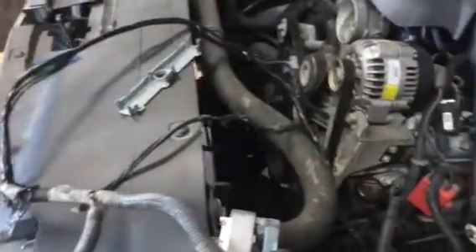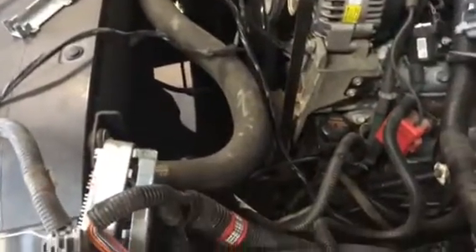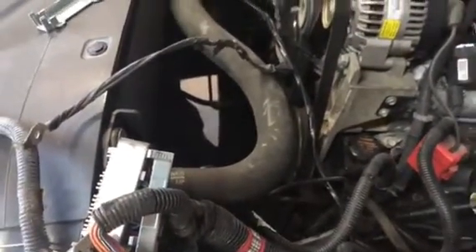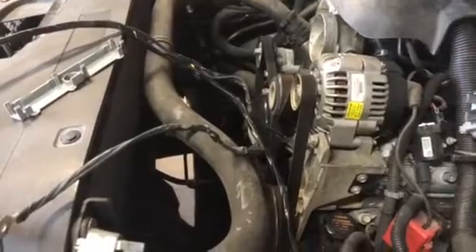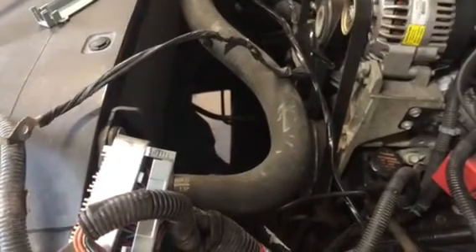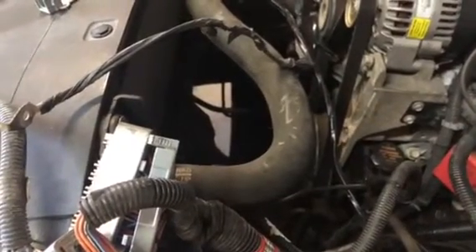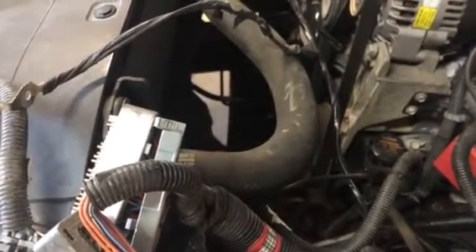That is pretty simplistic on how to do this. We just de-loomed the light part out of the front harness connector, and we're going to have to loom this all up to make it look nice — I've got it taped already. You'll have a ground; I'm going to run the ground back to this side of the truck. If you had an '05 and up truck, you'd have a hole on the passenger side of the front frame where you could put that ground in, but on this truck we don't. So we're going to go ahead and put it over here — since I'm kind of lazy, I'm just going to run it to the same one that the PCM is grounded to on the front, right behind the tow hook on the driver's side.